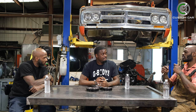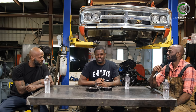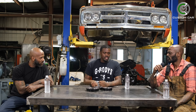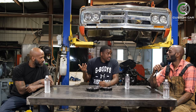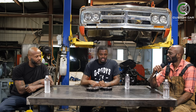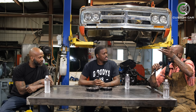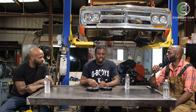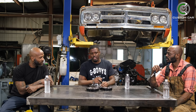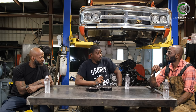So do you have to do all the chain reinforcing and all of that stuff? All that. Me, I don't like chains. I think you should know your setup so you don't need chains. So what's the point of the chains? It stops you. Like, this is your limit before you break something. Basically. Oh, okay. So that's why when you're going up, you keep slowly tapping it a little bit. Yeah, I tap it. There's been times I held it because I just know how high I can go. I blew seals here and there. They're a quick 10 minutes to fix if you don't mind being full of oil.